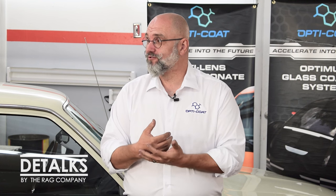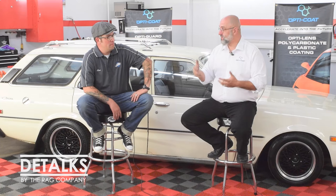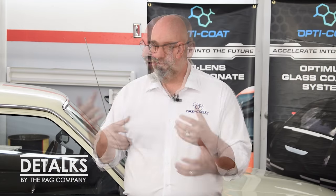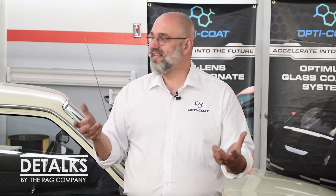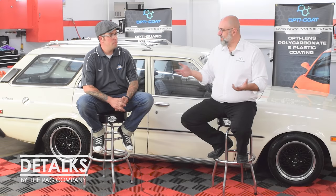I actually prefer to use the rotary for finishing. But if I'm doing a quick one step on a car, yes, the DA is the way to go for me. That's a personal choice. I like the rotary because there's no vibration. It's easy to control. I use a Flex rotary, and the new Flexes are really lightweight. It's comfortable, less noise, no vibration. Some people characterize some paints as sticky. Those paints always finish better with a rotary. You don't get the micro marring that you can with the DA.